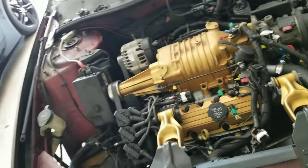Next thing we're going to do is take off the power steering pump. See this pulley right here? There are two bolts in there. You're going to twist this pulley until you get to the big hole. If you stick your finger in there, you'll feel a 13-millimeter bolt at 6 o'clock. Then go to the top of the motor, find that pulley — there's a bolt at 12 o'clock. You're going to spin the pulley to line up the hole, stick your socket in there, and remove that bolt too. Once you remove those two bolts, the power steering pump comes loose.